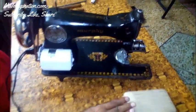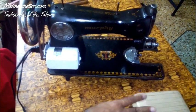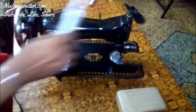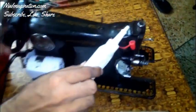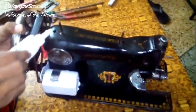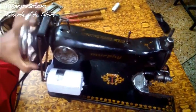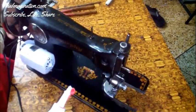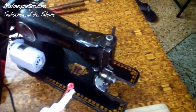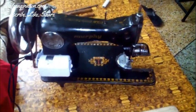After checking, it is working correctly and so smooth — we are able to fix the problem of machine jam. Now regarding oiling: oiling is really very important after each week. In a week, you have to oil your machine in all holes. Whatever holes your machine has, it will be marked with 'oil' written on them. First insert oil in the part that goes up and down, and all the parts shown — once a week you should oil your machine.